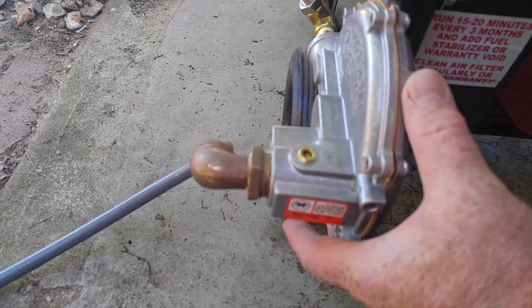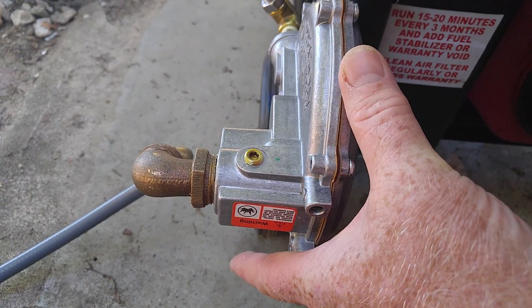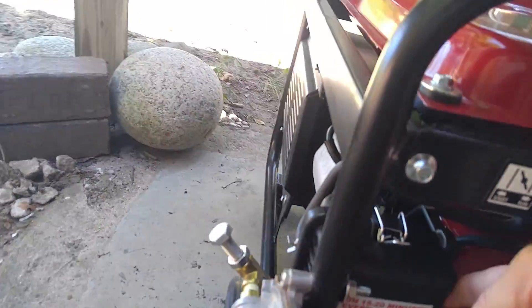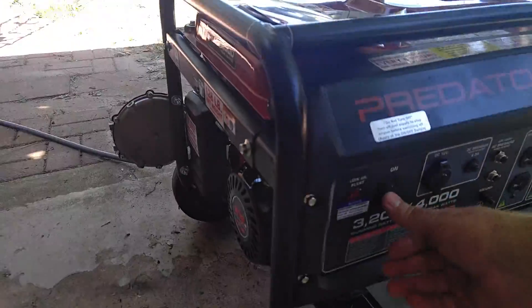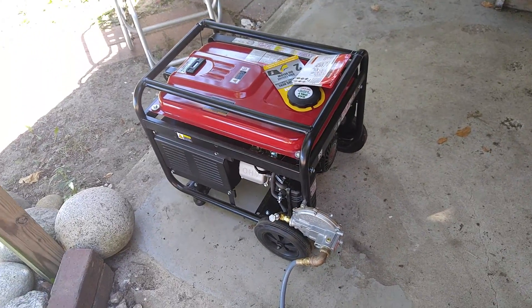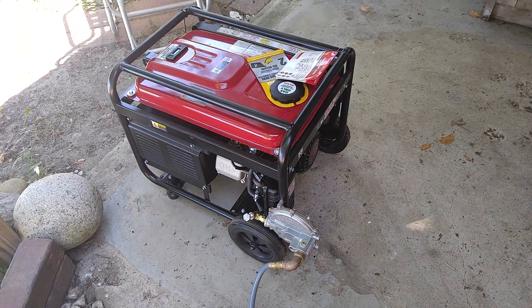The regulator seems to be working fine. I can cover the vent holes — unlike the last regulator, this seems to work fine. The air box is good and there are no vacuum leaks that I can see. The half choke doesn't cause too much of an issue on its face, although I think it's cutting the horsepower because it's not letting as much air flow through the engine.